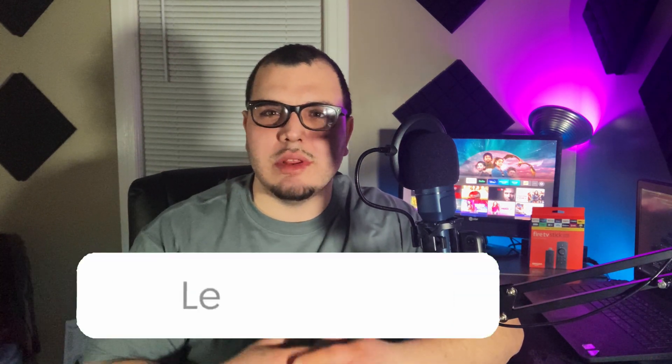I'm just going to click cancel because I don't want it to erase everything, but that's a great thing to do if you're stuck and can't do anything else — if you tried the soft reset and it didn't work, or when you come back into the Fire Stick everything's messed up and you just want a fresh start. So again, the first way was the soft reset, the second way was the hard reset, and you can do both with just your remote. You don't need to go into the settings or anything.